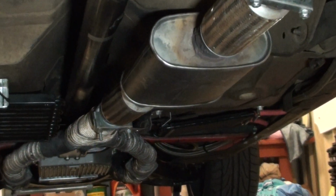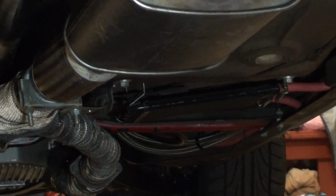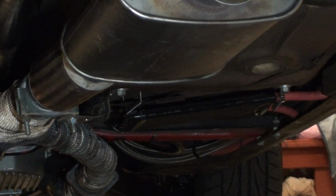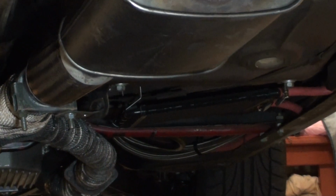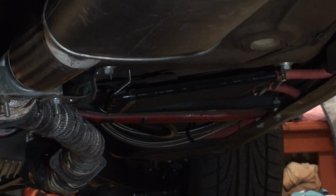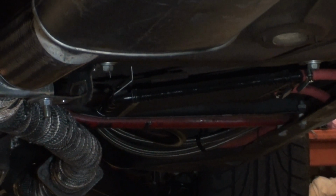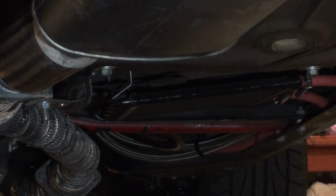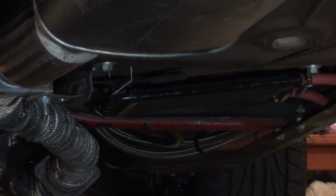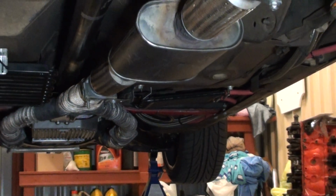Now on its way back, because the oil out of the turbo is really hot, because it's not a water-cooled turbo, there's a lot of heat. So to take some edge off that oil on its way back to the engine, I run a small transmission cooler, which would pull a few degrees out of it before going back into the engine, because it's surprising how much oil is actually feeding that turbo.